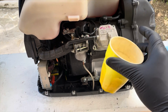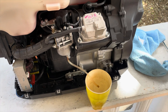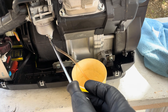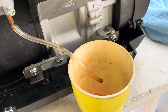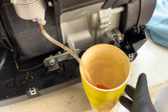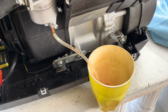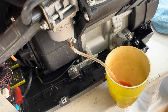Now let's pull out our handy dandy yellow cup so we can drain the fuel out of that carburetor bowl. Make sure that your switch, which also controls your fuel valve, is in the off position so no more fuel will reach your carburetor. If you notice the fuel is still coming through the carburetor bowl even though the switch is in the off position, that means the fuel valve is not closing.